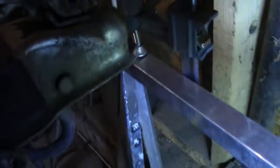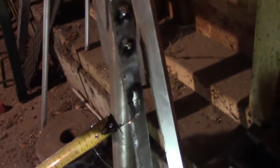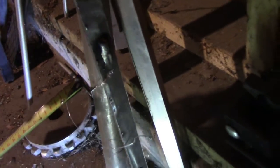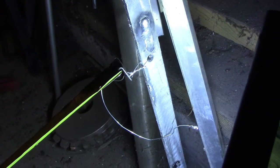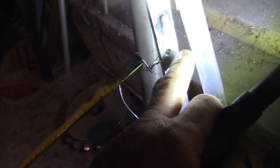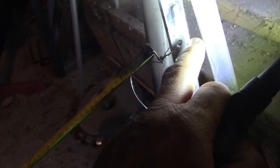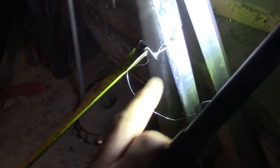So we got the axle cinched up. I got the rubber in between the axle and the aluminum, and I did a couple moves here — I want this as accurate as possible. I tried using Mason line at first but it's too stretchy — even though it doesn't really stretch, it stretches enough. So I ended up clamping this aluminum piece to the tongue, and this vertical piece is just a scrap piece of aluminum welded down, teed off so it's square — vertical right underneath the tongue. Then I took a tape measure and some welding wire, because when we swing it from one wheel to the other, I needed to have it accurate. Trying to hook the tape measure on one-handed kept falling off and wasn't going to be accurate. Doing it this way it pivots but it can't stretch.